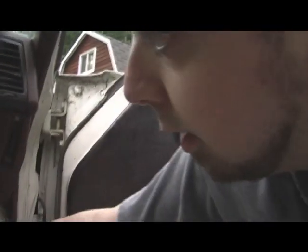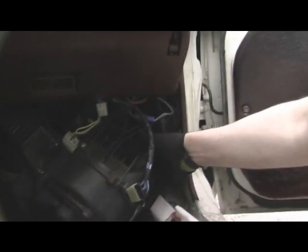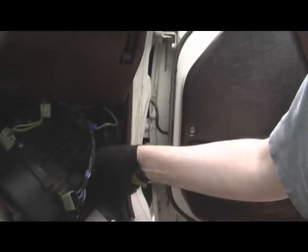A little bonus step I had to do there was just remove the blower motor for the heater — that was just three 10mm sockets straight up there and then one at the back. I just got to get all these plugs off.